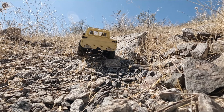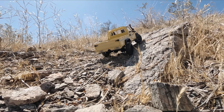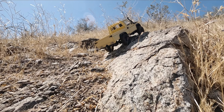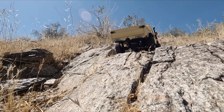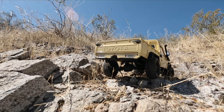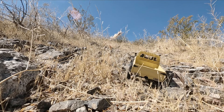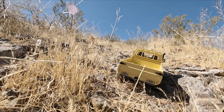Now some things I've done: I changed the front springs. The front springs are actually from a 1/4 scale RGT crawler — the fender crawler that they had back in the day with the big diffs on it. And I took the rear springs off of the dampers because you already have leaf springs back there. Why do you need springs on the dampers? And I have a 3D printed rear bumper and 3D printed rear fenders just to save the body a little bit on this trail run. They're not the prettiest and they're not the best 3D print, but you can always print better.